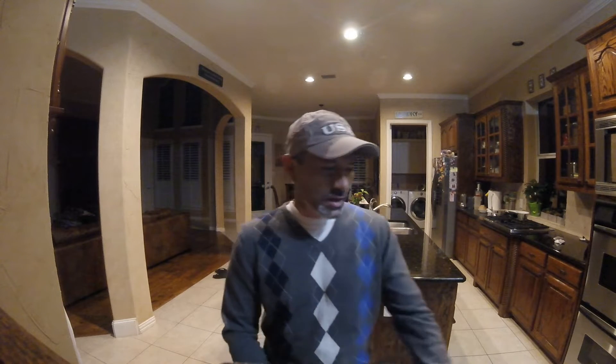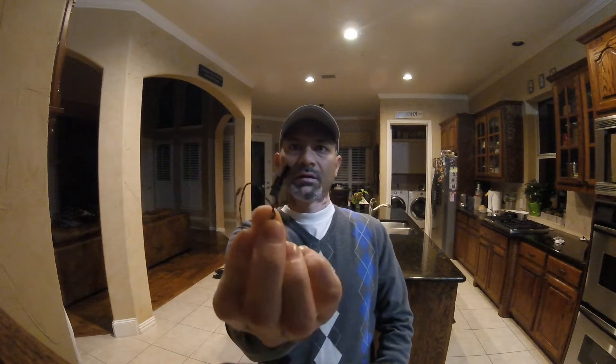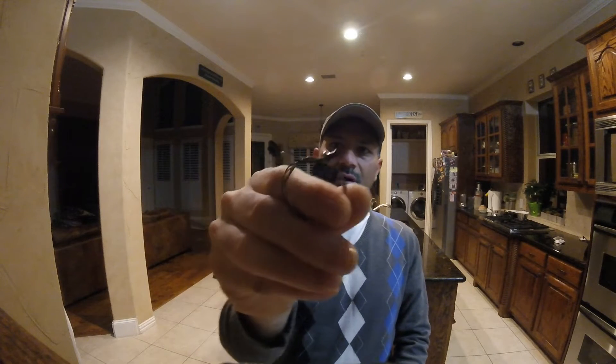So the first thing I did, I ordered — by the way, I was replacing a Samsung hard drive which was originally dead with a Seagate, and right off the bat there was a difference between the connectors. This is the connector from the original Samsung — as you can see it's a kind of square connector with a two-pin. The Seagate hard drive on the other hand had a flat four-pin connector, and apparently you need two connectors like this — the part number is right there.